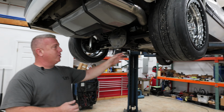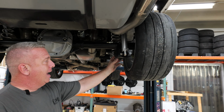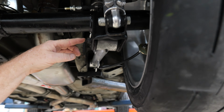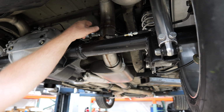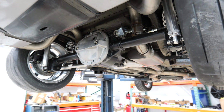The other thing about our urethane bushings, we use a really heavy tool steel pin that encapsulates the bolt. So you're going to have less chance of that pin getting distorted or getting pulled out under power. And that's true for our lower control arms with the urethane bushing as well as our upper control arm with the urethane bushing. It's a UPR exclusive. And like Shrad was saying, this thing should dead hook.